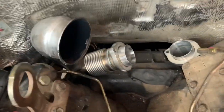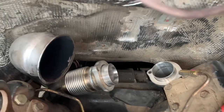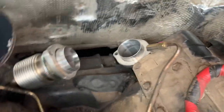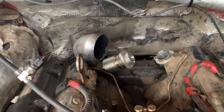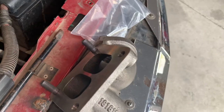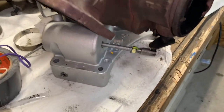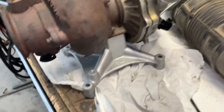Here are the Riff Raff Diesel up pipes installed. The driver's side was pretty hard to install — I had to take the rear cross member out of the transmission and drop the transmission down. I even had to use the porta-power and bend it a little to get it through. After about four or five hours working at it, I got it. Got a new collector, studs, nuts, and bolts for it. Here's the turbo and the new pedestal — I ended up keeping the eBPV valve on it, but I might delete that in the future.